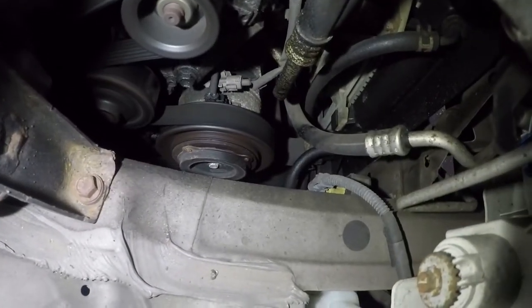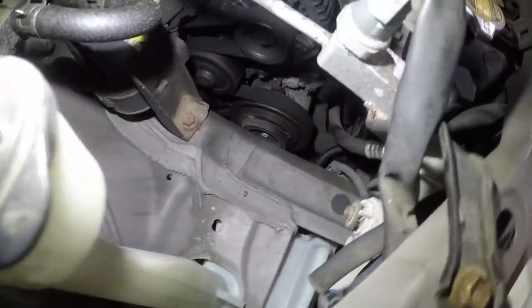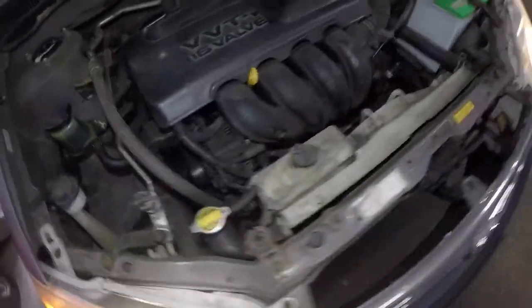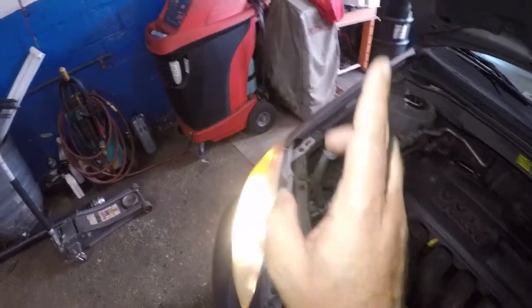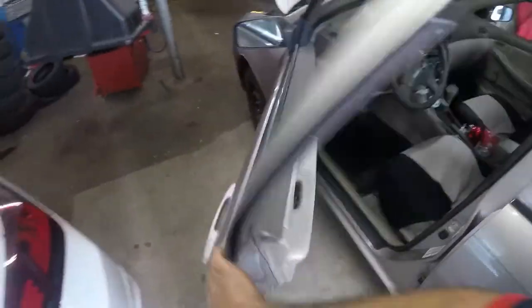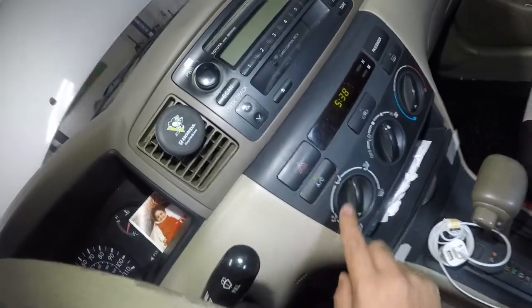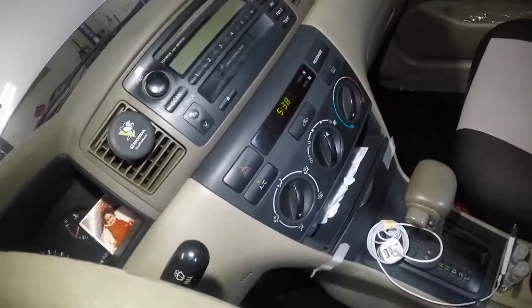You see that? You see the outside pulley is not turning. You're going to see the difference — it's not turning. But the fan is running. I did charge this car with Freon just the other day. And the AC light is on. I did not push this button, so the switch is on, and we did do a Freon service on this.